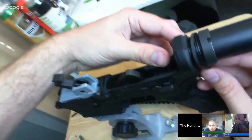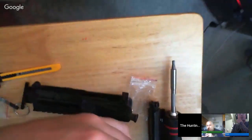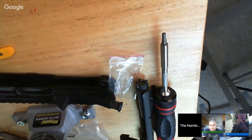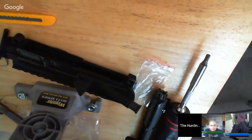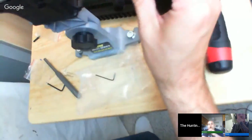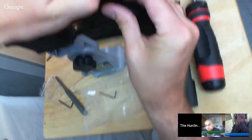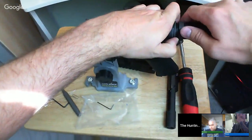Let's see. Now, this spring is on the other side. I just want to make sure it's fully lined up. What's the worst that could happen, right? That spring will go flying out in the middle of nowhere? No, by screwing it too much. Oh, I see. Yeah. I'm just going to need to, let's see. Grab some pliers. I'm just looking to get that spring there more or less straight. There we go. Can you guys see the spring? Sorry, I can't look at the TV. Yeah, kind of. Okay. Pull that nice and tight. Okay, I heard that spring snap in there, and now I'm going to start tightening down the castle nut on that.